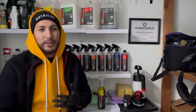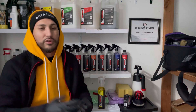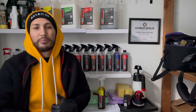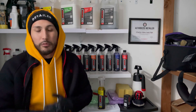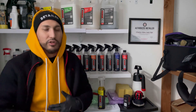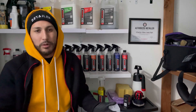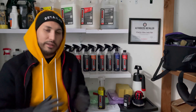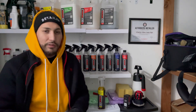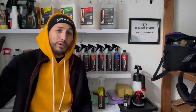I've used Rupes Uno Pure before on a BMW X5 when they received the Raw ceramic coating, and also on a Ford Marquis because it had soft paint. Even when we did a one-stop polish it gave a hazy cloudy finish, so we used Rupes Uno Pure as a second step, buffed off the polish, then coated right over it with no issues.